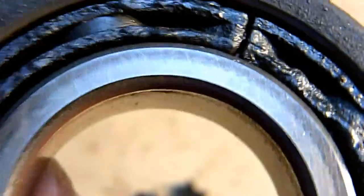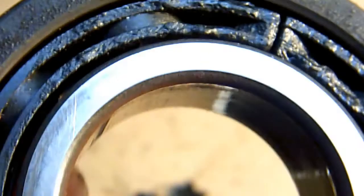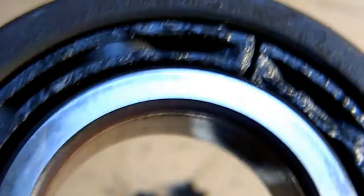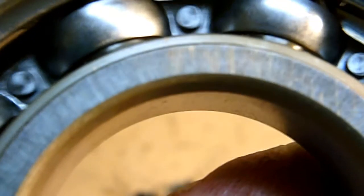You might see where this looks a little melted, but that's probably from me using the heat gun. I had to heat it up to get the Loctite loose to get the thing off, because they're put on the crankshaft with Loctite. If you want to take the bearings off, you're probably going to ruin that separator anyway getting it up to 400 degrees. So that's the modification — I'm going to change these bearings over to metal cages. The PTO side sounds fine, turns quietly, but these separators on this side are cracked, so I'm going to dispense with them and go with the riveted metal bearing separator.